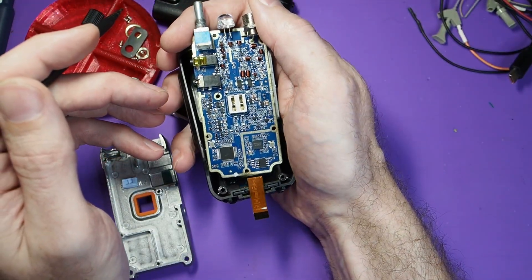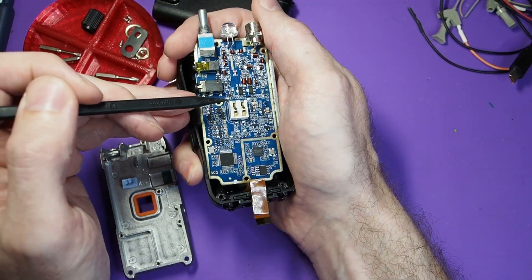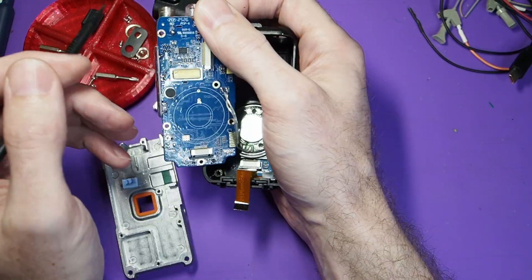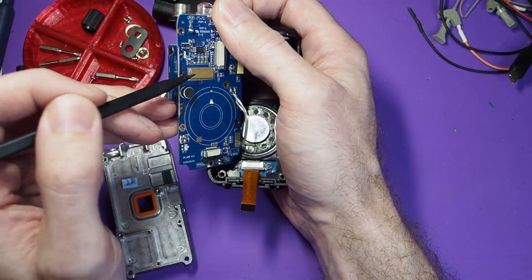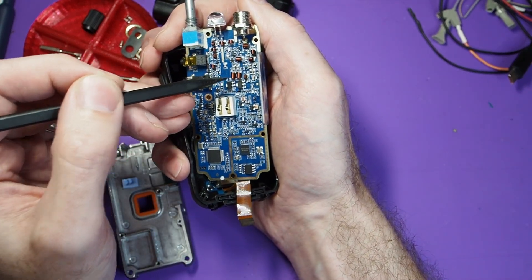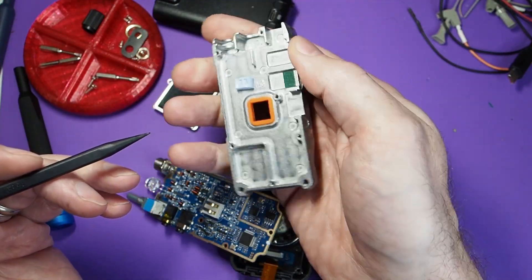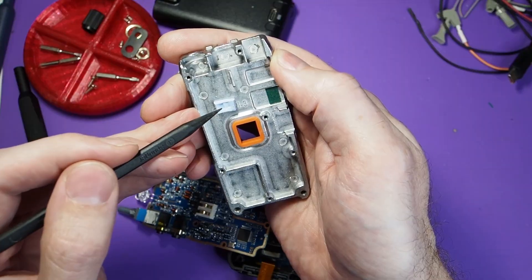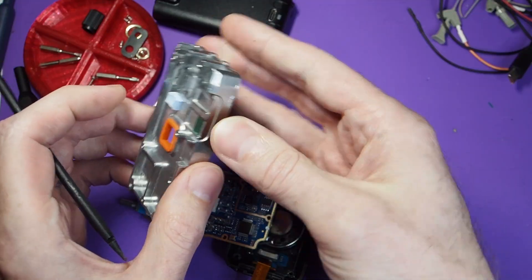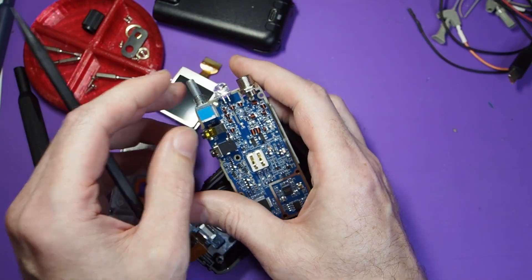The main power amps are up here on the way to the antenna — a couple of driver power-related ICs. Interestingly, they have a heat sink on the back: a chunk of metal acting as a heat sink on the back of those power MOSFETs. The coils actually rest into the thermal pad on the alloy case, so those imprints are from the coils themselves resting in there and being thermally transferred to the main case. They must be getting some heating effect on those coils while transmitting.